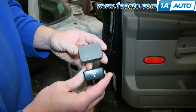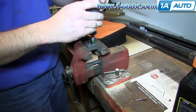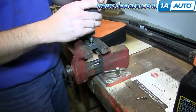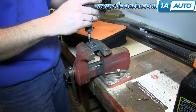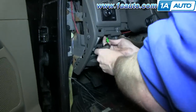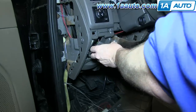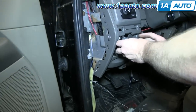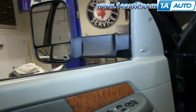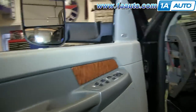We've run our wires for both doors and the wire for the switch. Now we're going to mount our switch into this small dead panel — use a Dremel tool to cut out an exact hole for the switch. We've run all the harnesses for both doors and the switch harness into the dash, and as a quick test the mirrors fold and move back.